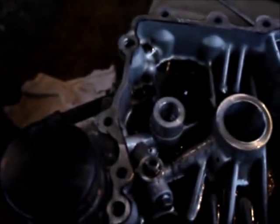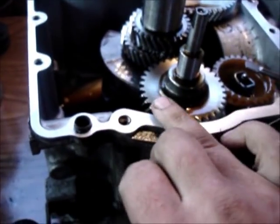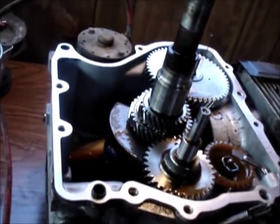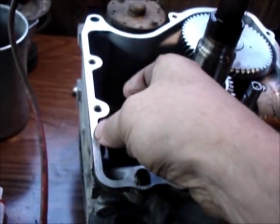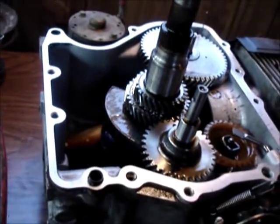Got these mating surfaces cleaned up nice. Couldn't quite pick all that silicone off of there — some of it just doesn't want to come off. But there's no gasket, so I'm just using this stuff here. It's always worked for me in the past. You just want a thin, thin film all the way around. You don't want to glop the stuff on there because it can squeeze out and come inside the crankcase, block up your oil sump, and you'll be done for. You'll be sad.